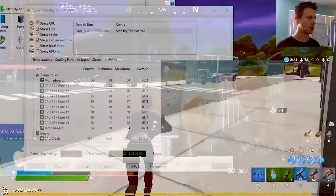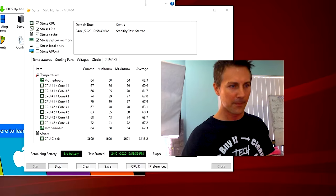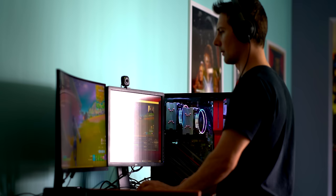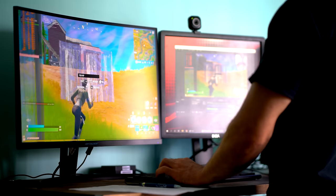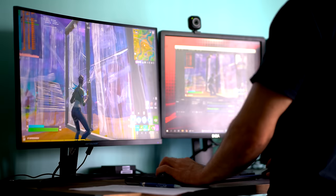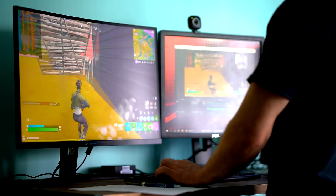The motherboard chipset heatsink, this was a little bit worrisome, because usually with a motherboard like this, they're running low powered Xeons. So the strain on the chipset as well would naturally be a bit lower. But I tested out the temperatures, and although the heatsink does get pretty hot, it's still fine for this architecture where it was going around 60 degrees constant. So if you were worried about that, you could put a fan on it. But after seeing those temperatures and the fact that we're in summer here in Australia, I really wasn't that cause for concern. Once you start going over, say 75 degrees on that chipset heatsink, then you should start really worrying about putting some cooling on it. But for what it's worth, it's absolutely fine for now.